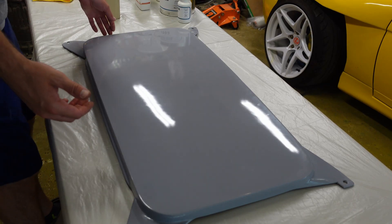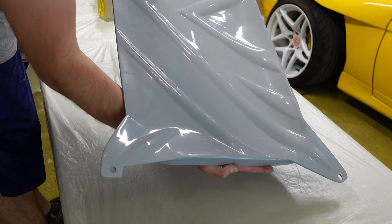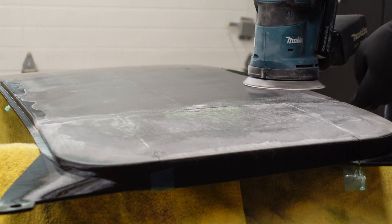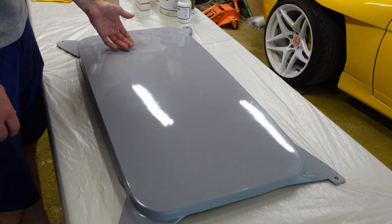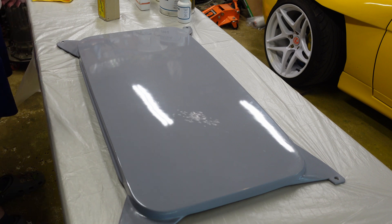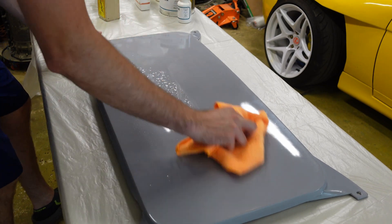In case you're new here, this is a 3D printed plug to delete the sunroof in my SC400. It is printed in 10 pieces on my Bambu Lab X1 Carbon, joined together with epoxy and little pegs, a bunch of epoxy on top, Bondo smoothed out, clear coated with 2K clear coat, sanded and polished. So that's where we're at now — I think it turned out pretty good. The first thing I'm going to do is just clean it and degrease it since it's been sitting in my garage, to make sure we don't contaminate the mold.